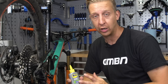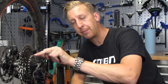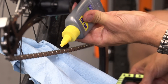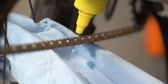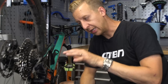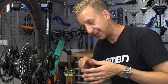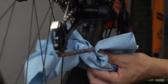Because it's summertime, I'm going to apply a dry lubricant because I don't want to attract any excess dust and stuff to my chain. You want to make sure you apply it to the inside of the chain links — you often see people applying chain lube to the top side by the cassette, but all that does is put loads of lubricant all over your cassette. You really want it on that inside to help get it in the right place. So I'm just going to cycle it backwards, holding a rag underneath to catch any excess. Now it's also important to note that you want to just leave this for a minute, especially with the dry lube — it uses that wet stuff as a vessel to get those lubricating particles into the right place. So just leave it a minute or so, make sure it works its way in, and then you can wipe up the excess.